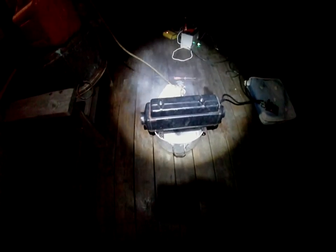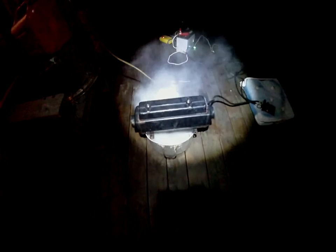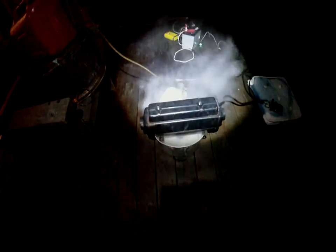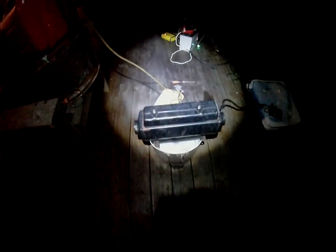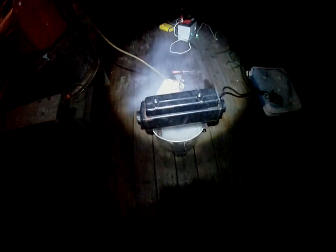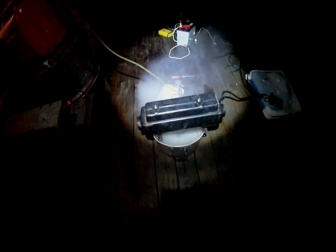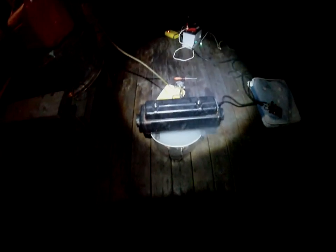After soldering the little controller, the unit actually works, but it's giving out a lot of smoke. I think that is due to the diesel pump not putting out enough pressure — it doesn't work as it's supposed to. The smoke is, in some periods, a little bit less. I think it's actually turning off, or maybe accelerating, I'm not sure. But it's way too much smoke. I don't think the pressure of the diesel pump is high enough, so it gives droplets instead of a spray. But that's another issue.